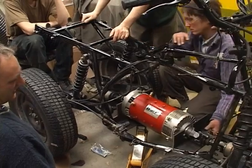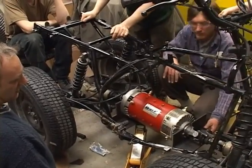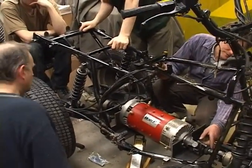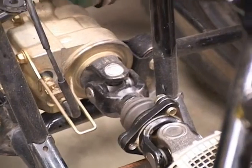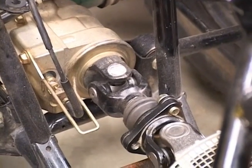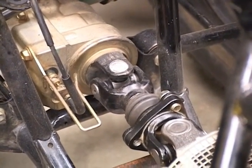After removing ICE components, you focus on mounting the electric motor. To do that, we had to address a couple of things. The motor shafts were too long, so we reduced their size by cutting each end off the shaft. Then we had to find a universal joint that would connect a new yoke on each motor shaft with the old original yoke.